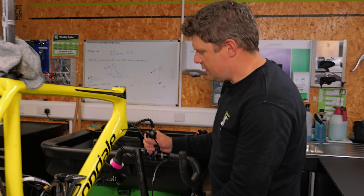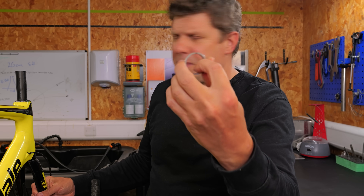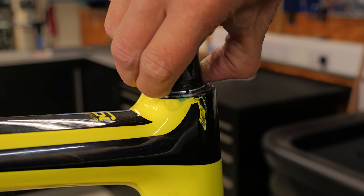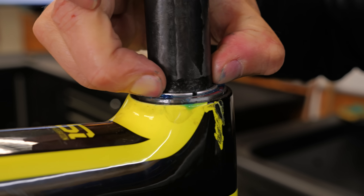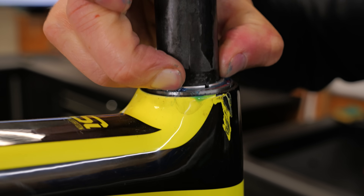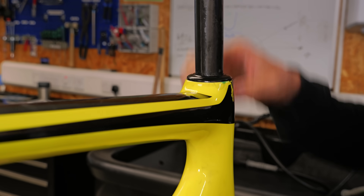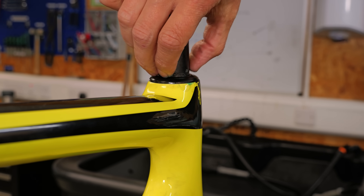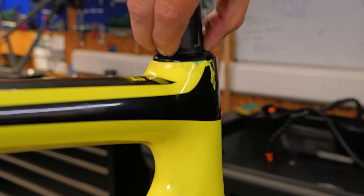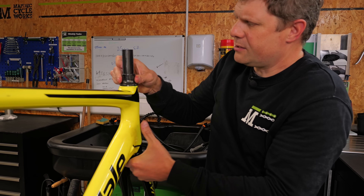When reconstructing these forks, a few things to look out for — especially with Cannondale headsets. This one uses an aluminium compression ring, so we've got that gap that we can close. It's worth a quick check to make sure that as you push on this, it's actually going to grip. Then your top cap: with Cannondales, you have this little top cap for if you really want to slam everything — it should press onto the compression ring but not interfere with the paintwork. You should just see a tiny gap between the top cap and the paintwork.